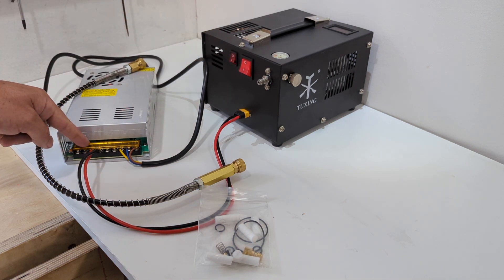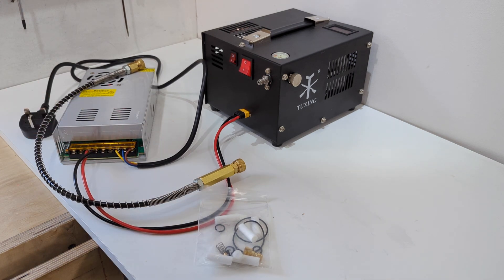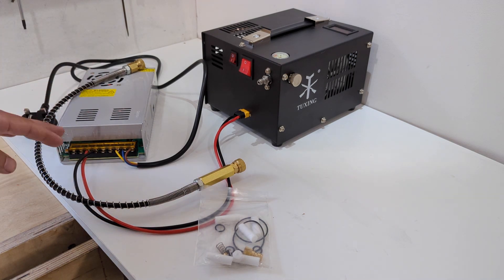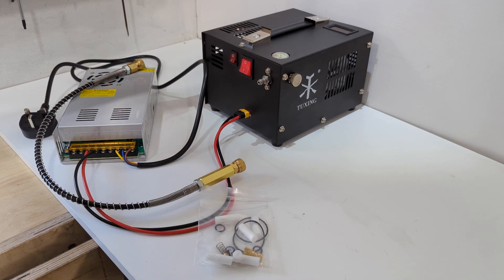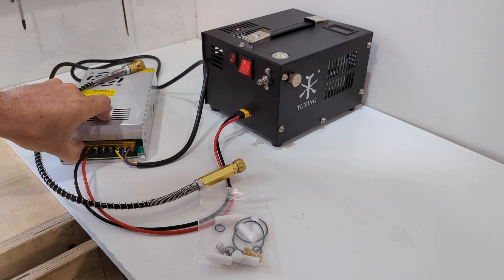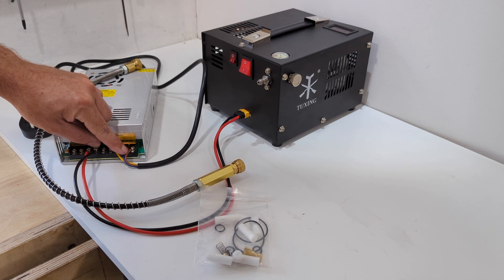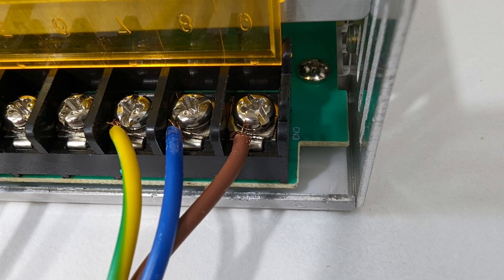So what we need to do now is zoom in and I need to show you the power supply. This is the mains power supply for the compressor. The power in and the power out are incredibly dodgy — these are the parts that previously failed British standards testing. This is looking like the revised version and it's still equally sketchy. Now I knew what I was getting myself into; I am competent working with the electronics and I could rebuild that compressor no bother. If you're not mechanically sympathetic you probably should avoid it. Underneath this little flip-up terminal we've actually got some pretty poor wire, and we've got some flyaway leads on the live here. So although you've got something of a dodgy cover we've actually got some exposed cabling, and this really needs some cable strain relief to make it a bit safer.